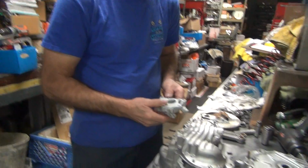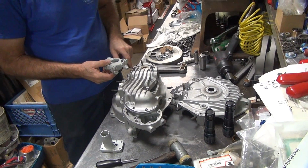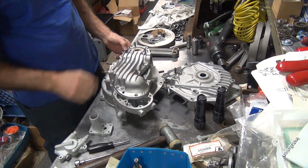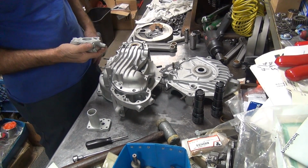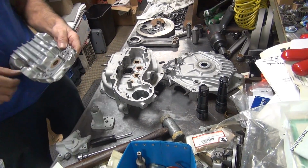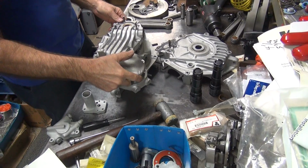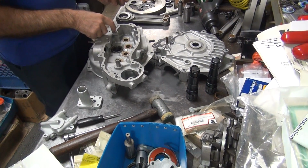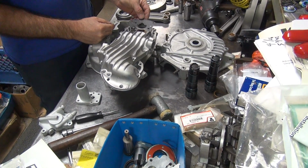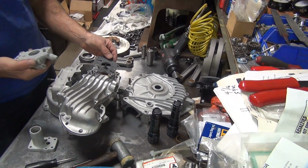So why they bleeding over this? I don't know what this one does. Okay, this is the hole that's feeding our crank. Thought it was the one where your thumb was. This hole goes directly to the pinion shaft. This hole comes out the bottom here, which feeds into something on this side of the case. That goes in this gallery. It goes into happy time. So they're bypassing something.